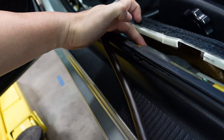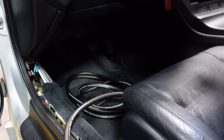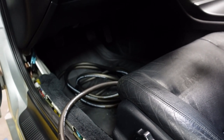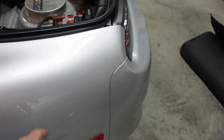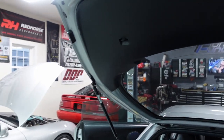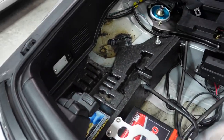These cars are to the point now — especially as much as we remove — that the whole car probably needs rewiring. We're damn close to that. That wiring can be a lot smaller and more efficient, because the taillights aren't halogen anymore and everything is just simpler. So everything can be less wire, smaller wire, simpler. Besides the third brake light, there's no wiper anymore. There are a couple other wires up there and there's just a lot more stuff that can be removed. It'll run back behind there once I get that section tidied up, then I'll bolt that down and run it up and over.